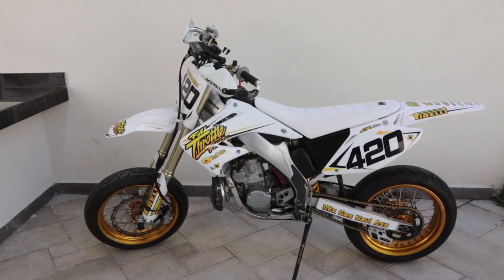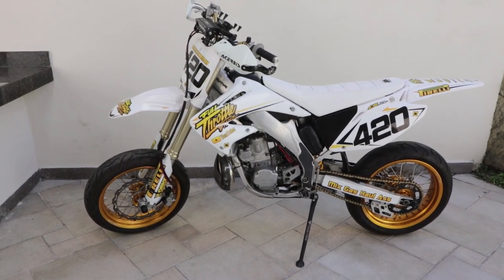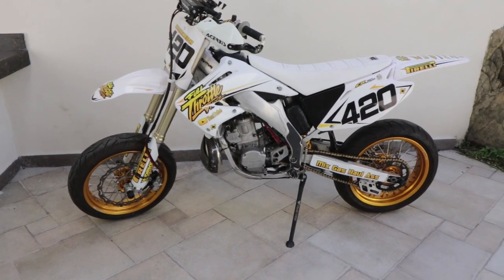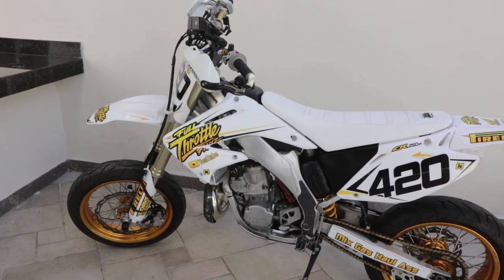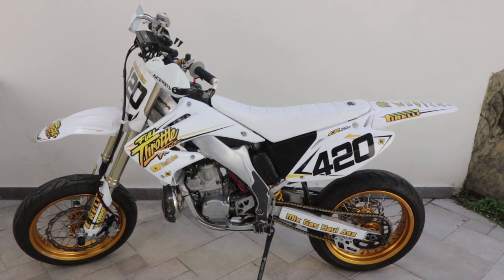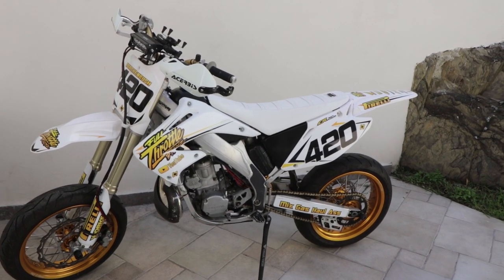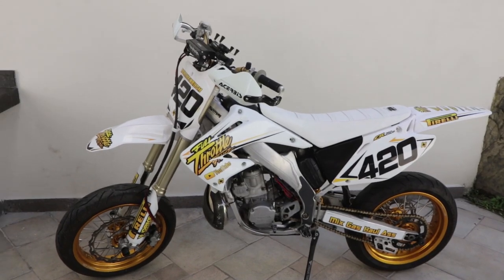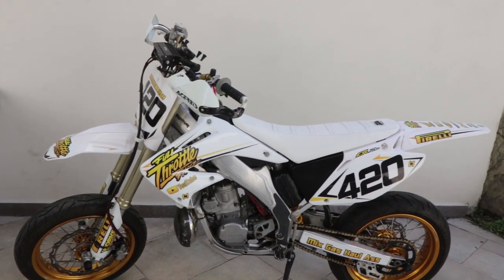So there you have it. That's how the bike is running right now. And I gotta be honest, that wasn't a true cold start. I actually forgot to have the microphone turned on the first time. So it warmed up a little bit, but you can see it idles okay. It actually starts to even load up with oil after just idling a little bit. And if I don't rev it completely and clear it out, it just gets all clogged up and loaded up, this carburetor. And then the bike sputters when I try to hit the gas.